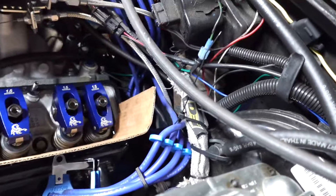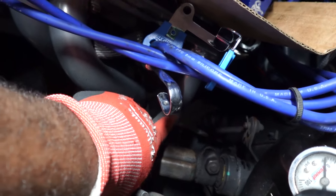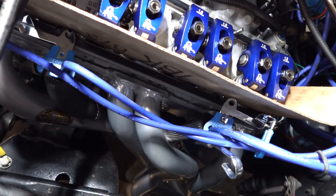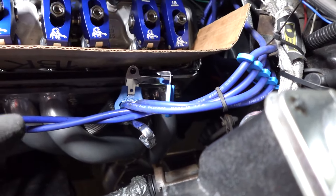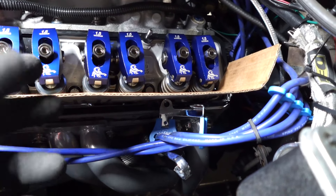I also want to point out — last time I did this, one of my zip ties was sticking up and touching the exhaust tube, started to burn a little bit and gave off a smoke smell. So I've positioned my spark plug wire hold-downs up and made sure anything that can contact the headers is moved out of the way. When you're working like this you want to be careful with oil sloshing over and getting on the header tubes, because that can cause burning and possibly even a fire.